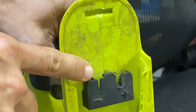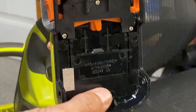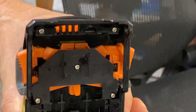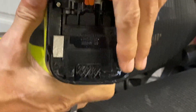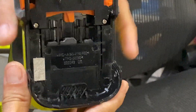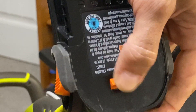So now when you put a Rigid battery on there, positive and negative are the same — it's two terminals. It's not using the temperature sensor; temperature sensors only seem to be used for the charger side. Now when you put that Rigid on there, it clips all the way down, nice and flush at the bottom. The clips click part way — you can knock it up a bit and it goes into the clip sides there. That will just prevent the battery from falling out. It has to be all the way down to actually function, but all the way down is nice and tight. If it comes loose it's not coming out unless you actually depress the clips.